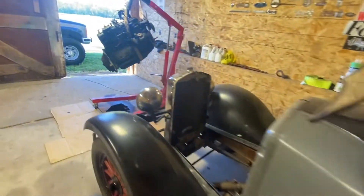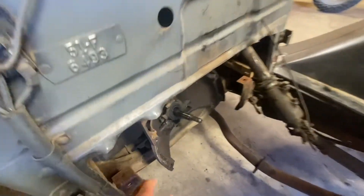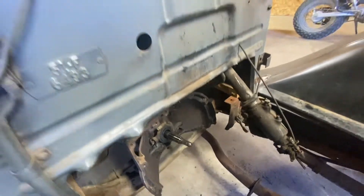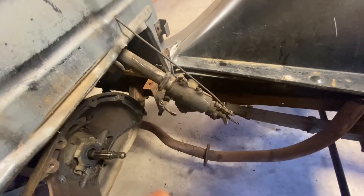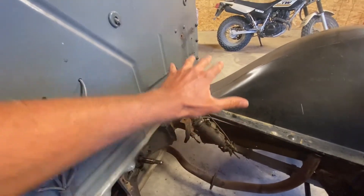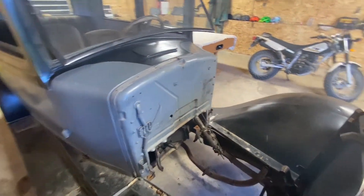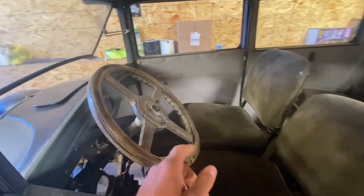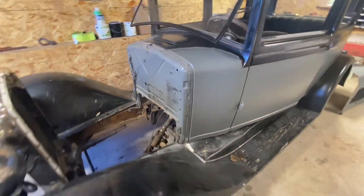So my plan for this car — don't laugh at me. Maybe it's been done before, I've never seen it done in a car like this. I'm going to take the clutch off and steal the plate back. This is like the perfect car to do this with. The plate bolts back in here, the transmission pulls up and the housing bolts hold it secure. Then I'm going to get a one-inch shaft welded on here, put a bar across to a hanger bearing, put a sprocket on here, and mount a 13-horsepower Honda motor right here. Put a sprocket running down to that, and with the hood and everything back on you'll never know. You just pull the rope, the car starts up — a nice reliable little motor parade car. You'll still have your gears, they'll be more like ranges since I'm not doing a clutch, just a little centrifugal clutch.